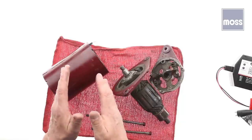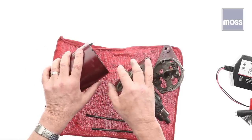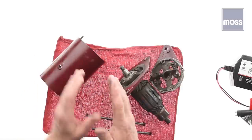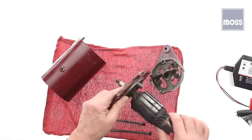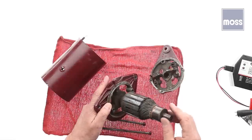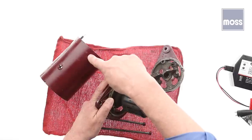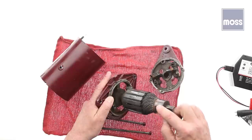Now, amazingly, the generator and voltage regulator — or if you have an alternator with an internal regulator — will usually survive this kind of heavy charging. That's why we usually get away with it; that's a tribute to the way these units were built. But did we really get away with it? Sometimes yes and sometimes no. If we lost the solder holding one of these connections together, we still have a functioning generator, but we've lost a percentage of total potential output. The remaining parts are going to have to work extra hard to make up for the failed ones, getting hotter and hotter, and a cascading effect begins to happen.